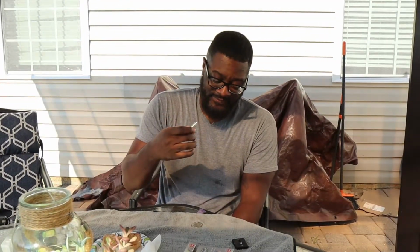Oh, man. Day two, guys. We're gapping spark plugs. Still gapping spark plugs. I've already gone ahead and gapped the first one, but I'm gonna show you how to gap spark plugs. It's a spark plug gap tool. For the 335, you gap around 0.018 to 0.022.